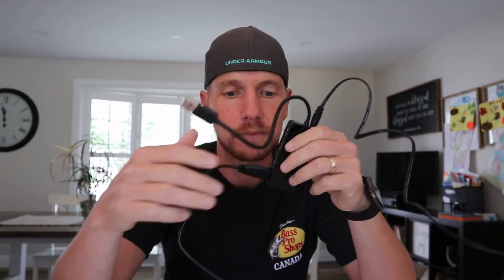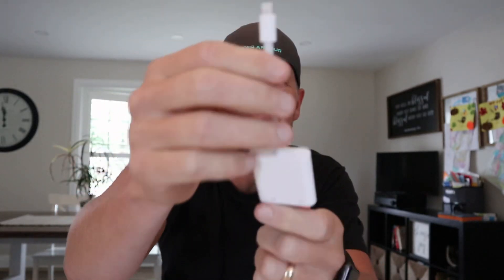Quick recap: you need a powered USB hub — this is for an old iPad, not an iPad Pro. Plug that USB hub into the wall. I got mine on Amazon for about $20. You need an external hard drive; plug it into your USB hub. Then connect the USB hub into your iPad lightning-to-USB converter, and plug that into your iPad. Go to the Files app and it should show up there. If you already have Files open, you might need to close and reopen the app.